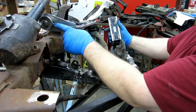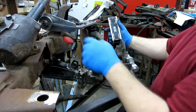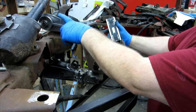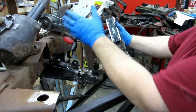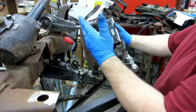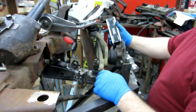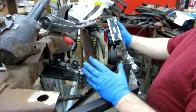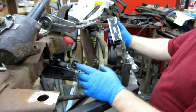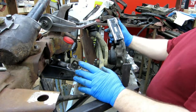What I might do is go ahead and shorten that upper control arm up like a 1/16 of an inch, because I did put a 3rd washer in the backside there, because I was further out than a degree. So I put 1 washer in. Instead of putting 2 in, I could go ahead and shorten that a 1/16 of an inch. That would still leave me some room on the other side to take a spacer or 2 out, and that ought to work just fine. So I need to run it through the range of motion and that stuff, but I'm tired and I'm late for bed. I got to work tonight.